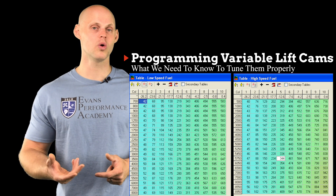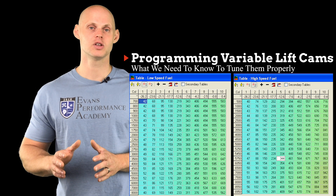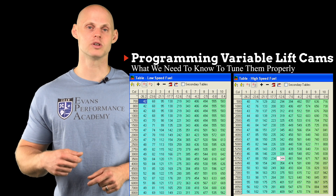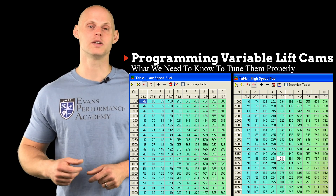We can go ahead and control the fuel delivery just for that specific high cam event. So if we ride on our low cam and switch to the high cam, we're not going to have to worry about blending one gigantic fuel table. We're simply going to switch over to this table and be able to hit that exact fuel delivery that we want.